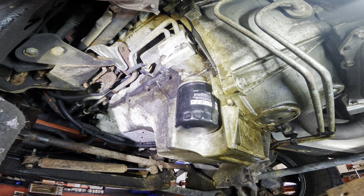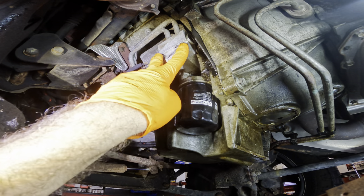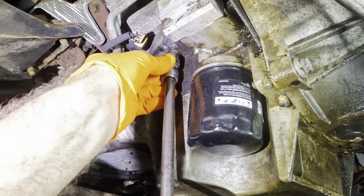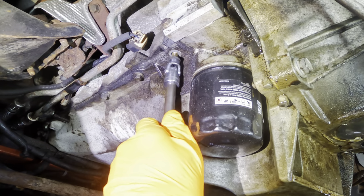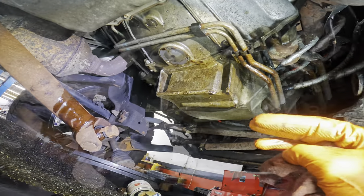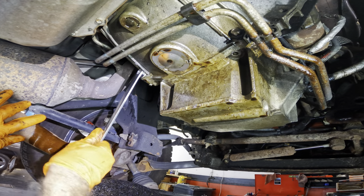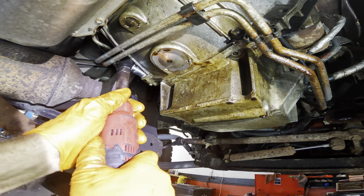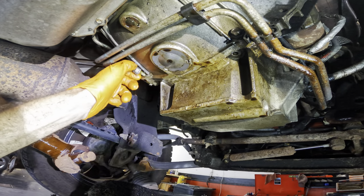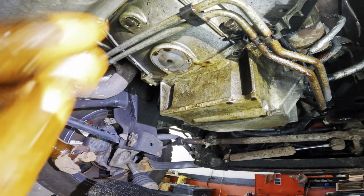Oil is getting a little scarce here, it's almost done. I'm going to go ahead and start pulling these bolts out. I think 15 or 16 around the perimeter. Two in the back - two big ones in the back. And then two up here for this oil cooler manifold assembly. Then the pan will come down. Start pulling these guys out with a wobbly 10. We'll speed this up until super close, ready to come out. Two more bolts back here, the big 15s. Someone's been in here before because this bolt has witness marks on it. And that one up there is mismatched.